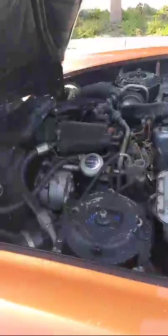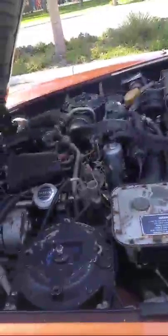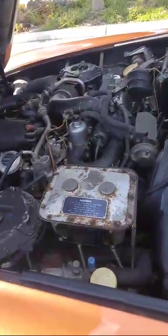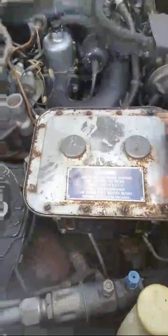We're going to take a look at the engine right now. This particular model has the 6,750 cc motor — right there. It's a big Rolls-Royce motor. This is the braking system — a hydropneumatic suspension from Citroën, which uses two brake accumulator spheres. Those two brake accumulators are half-filled with nitrogen and the other half with RR363 brake fluid, which is Castrol.